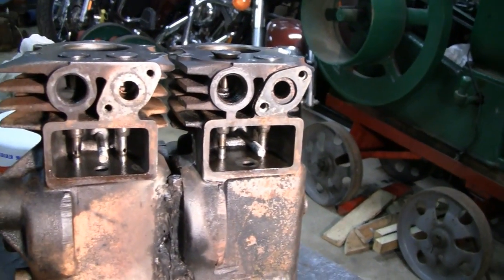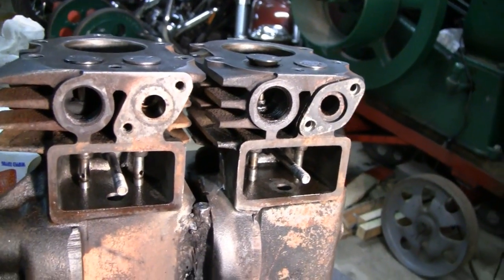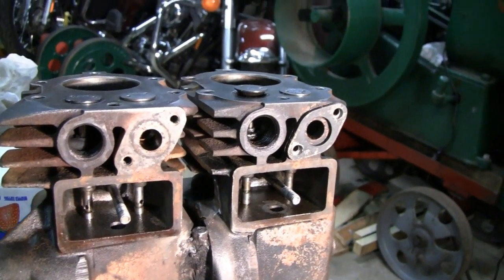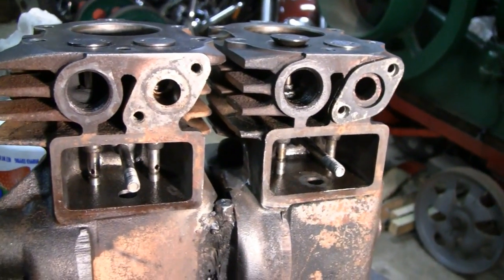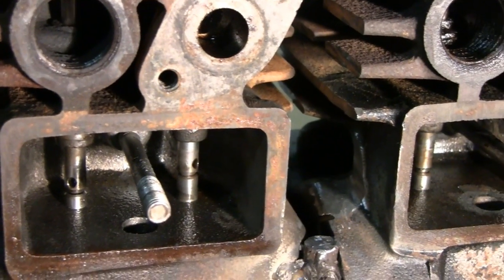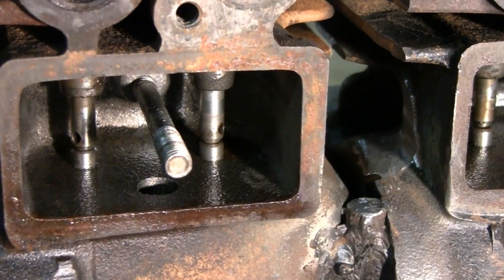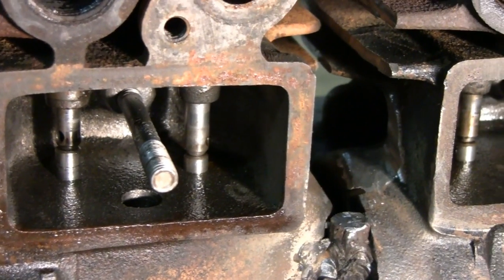It's just me today during the week. Mike is at work, and I was gonna hone this thing out and lap the valves to get it ready for when Mike comes back. He's working on a crank right now. Before I started lapping, I noticed the valves are gonna need adjusting. You can see the one on the right going up and down — that's the intake valve — there's absolutely no clearance on that at all, and it should be about eight thousandths.